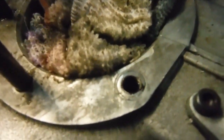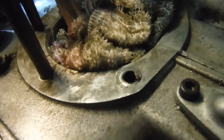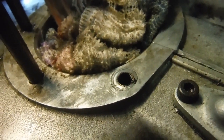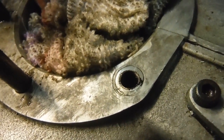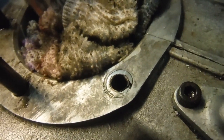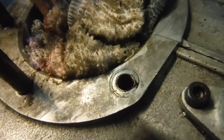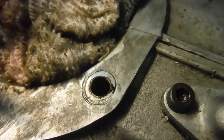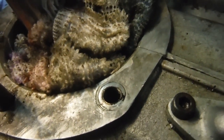I've managed to get the old botched helicoil out of the crankcase, which left a hole with no threads left that would have held the helicoil - they were all stripped out. Further down the hole was a little remainder of the original thread size for the stud, but not enough to screw it in reliably, so I had to do something. I cleaned out the hole and found a tap of a suitable thread to go with a high tensile bolt that would give me enough wall thickness to make a very strong thread insert.